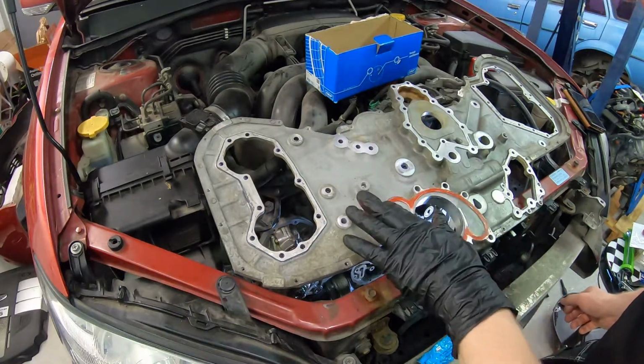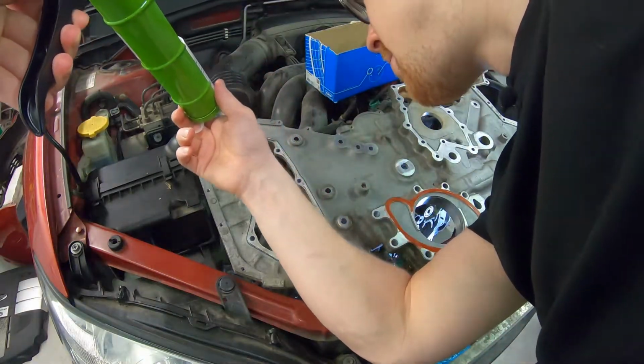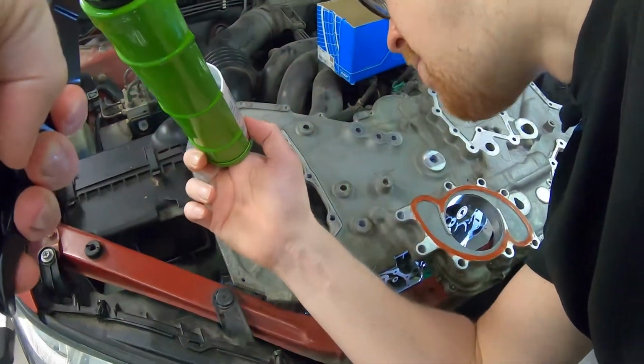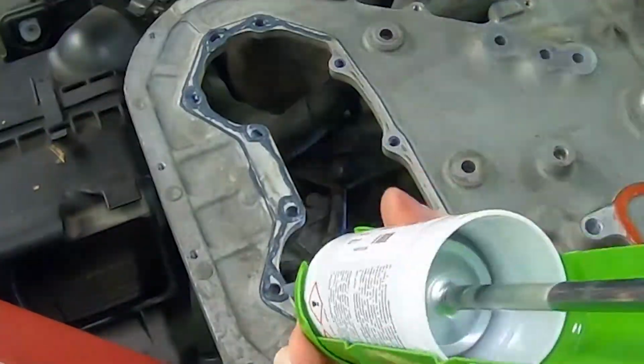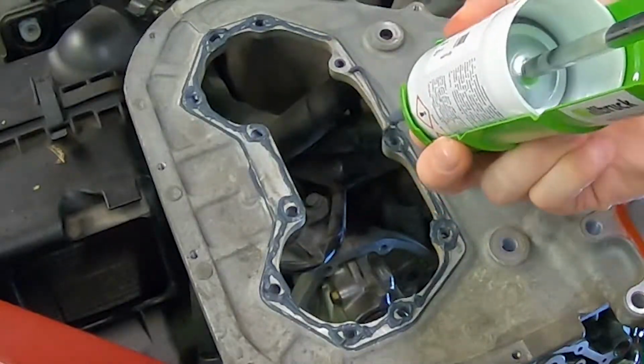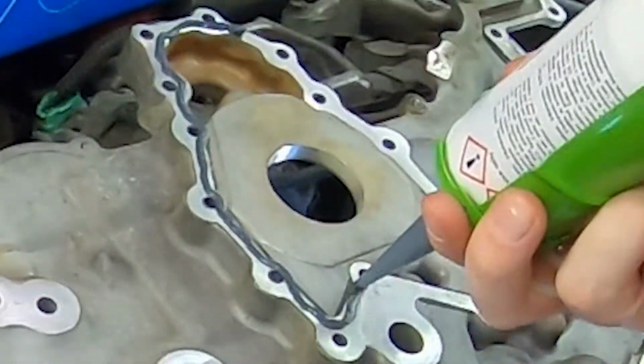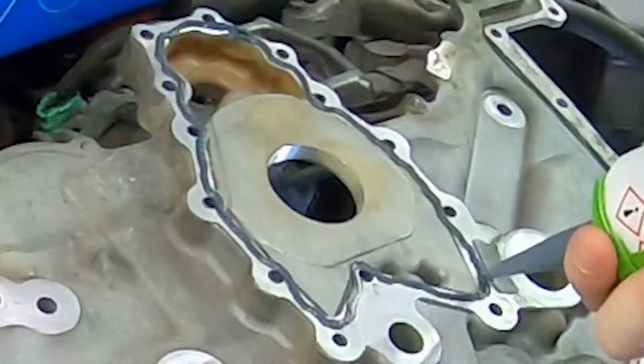At this point, I felt like it was time for less talky and more worky, since the RTV has about a 5-minute window until it starts to harden. When applying the RTV, make sure you seal around the bolt holes as I'm doing here, otherwise the oil may leak through the threads.